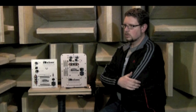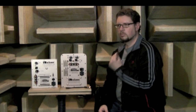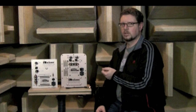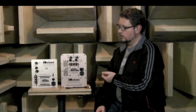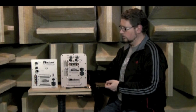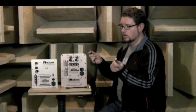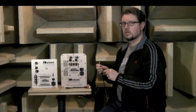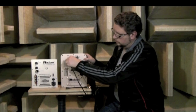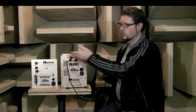How do I wire multiple subwoofers? There are some home theater receivers and processors on the market that have more than one sub-out on them. Usually it'll only be two if it does have more than one, and in that case it's very straightforward. You're going to run a separate RCA cable from each of the sub-outs on your receiver to the RCA inputs on your two subwoofers.